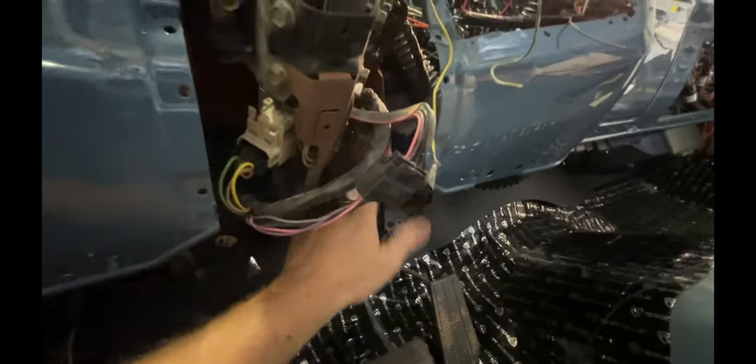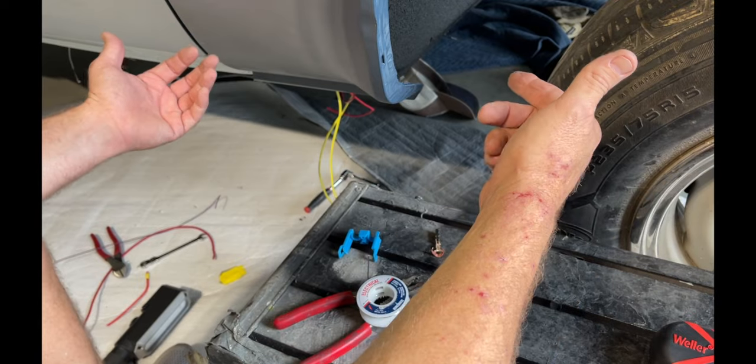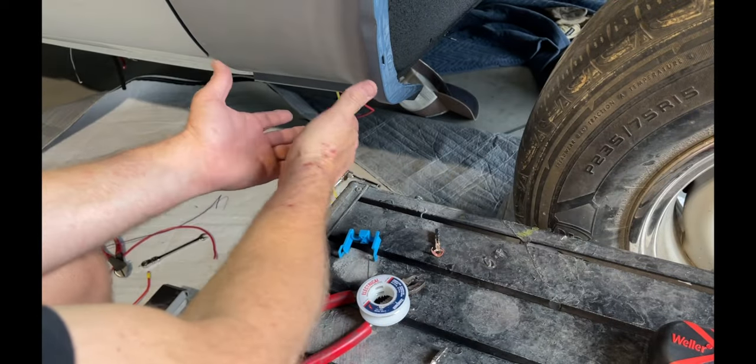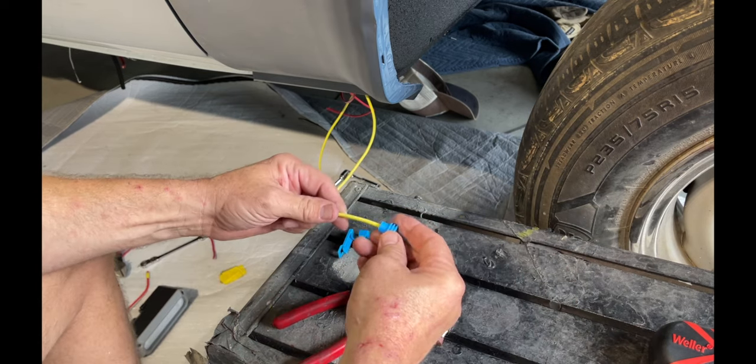That's gonna be the brake switch. Gotta put that in. I've got all the wire run from the fans, everything I can, all the way to this point where I'm gonna pick up power. Now I'm gonna solder on the ends for the maxi fuse.